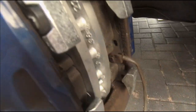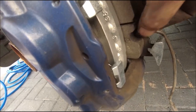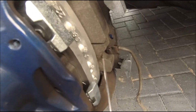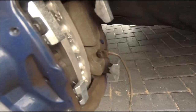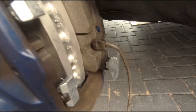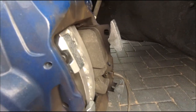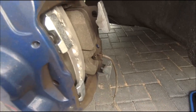Don't forget on these - there is a wear limit sensor. These just basically pull straight off - grab them there, or get a little flathead screwdriver under there and just prize them off, just like that. They clip back in again. You can reuse them - BMW say change them, but you can reuse them as long as they're not obviously past your wear limit, because it basically grinds the top off and shorts it out.